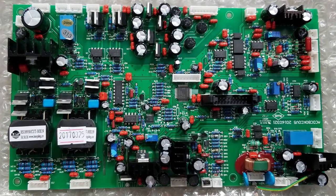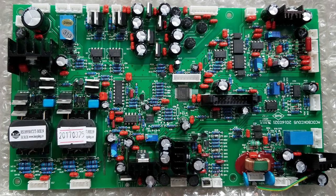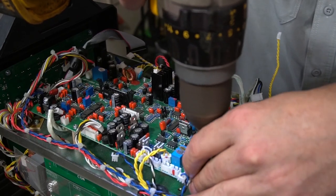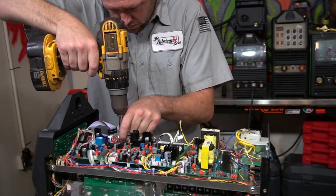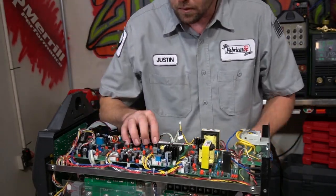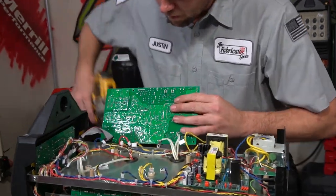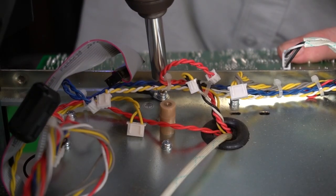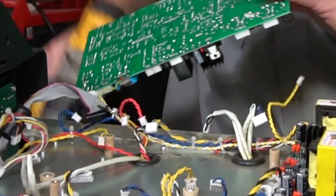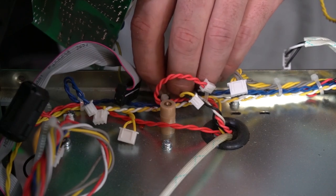For ribbon cables, there's usually a tab on each side — just press down on the tabs and it pops right out. Sometimes you can't see how the board is mounted when it's actually on the chassis, so it's a good idea to look at the new board and find your mounting locations. In this case, we have four screw holes that hold the board down to the chassis. If you can't find where they all are, just look at the new board and it'll show you exactly what you need to do. As soon as you have it loose, make sure you lift up slowly just in case something else is attached — in this case, you can see the earth lead. I still had it attached and I missed it, so always lift the board very slowly.